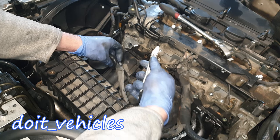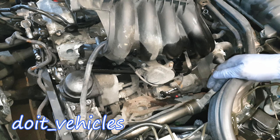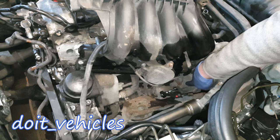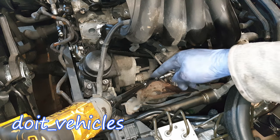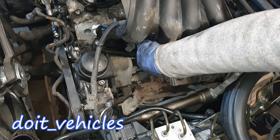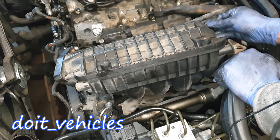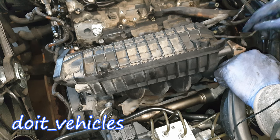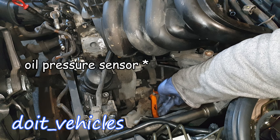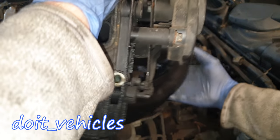We still have these wiring harnesses going through. Down here under the intake manifold we've got a bolt — we need to disconnect the wire from the starter solenoid. Use a 10mm and disconnect the bolt from there. You can also use a long extension, which is much easier. Now we've got the connector for the intake runner, so let's unplug it. Now you can pull out the wiring harnesses with the connectors. Cut these zip ties.